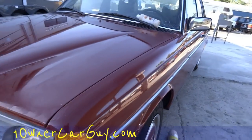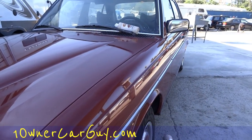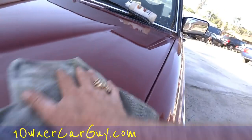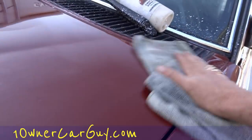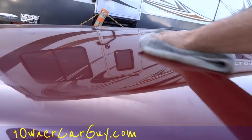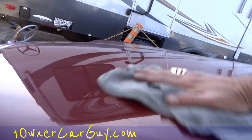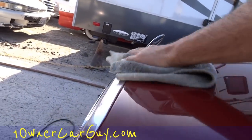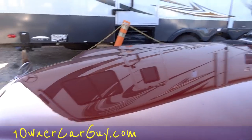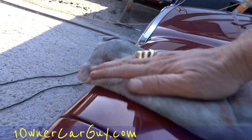You can see it does a lot of difference. It really takes a couple of passes at this to get the paint to where it should be. You're basically putting one set of scratches in that are one size, and then when you come over with the second stage, you're scratching it up with smaller scratches on top of them. I've had a lot of people ask about this kind of video and I finally decided to take the extra time, because when it all comes down to it, that's what it's really about — time.